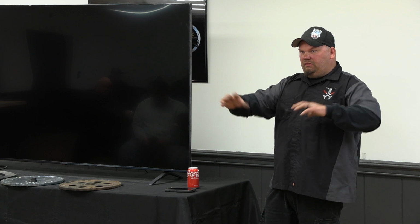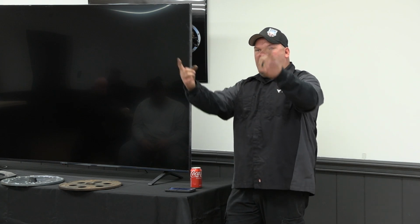If you set an old school turbo 350 or 400 next to a 4L60, you will see the castings are completely different. They're very robust, very rigid. They got veins that go up behind the valve housing and everything. Even in the late 80s, early 90s, GM factory four-wheel drive trucks were breaking bell housings because it was so rigid, nothing was supported. So they had the lower shield that bolted on that was heavier duty, and they had the rods that went up, and these big braces that came off transfer cases because they were so heavy, and it became an issue. As the engineers went on, and the new trucks go 300,000-400,000 miles, they're not breaking the factory bells. They designed them pretty good. It's all ribbed and structured, and it's pretty cool.